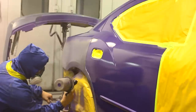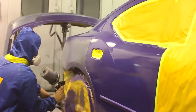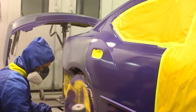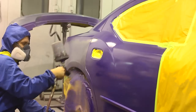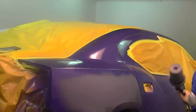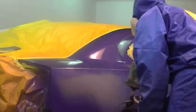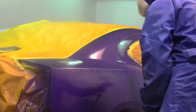Here's the color going on with my Devilbiss Techna gun. I want to address a question from Philip Hall about SATA guns and picking a spray gun. The Techna gun is my favorite all-around — my favorite base coat gun. If you have one gun, this is probably the one you want because it handles base coat really well and handles clear coat fairly well too, though it doesn't handle clear coat nearly as well as a SATA RP would.